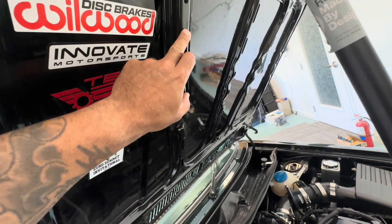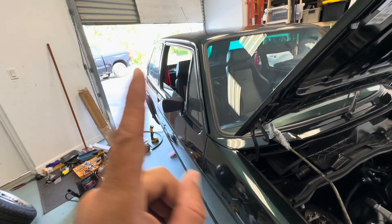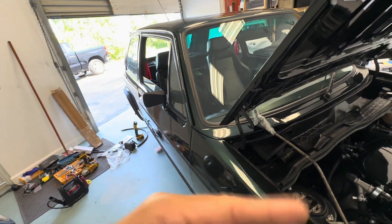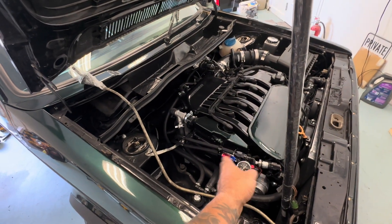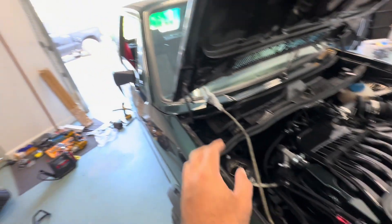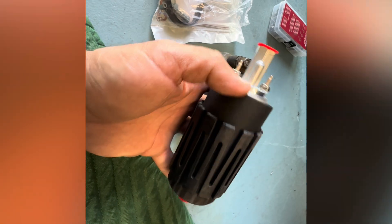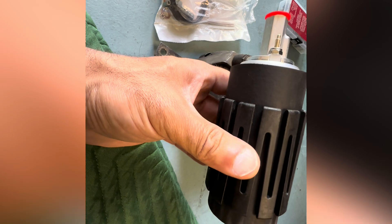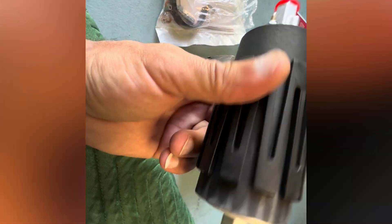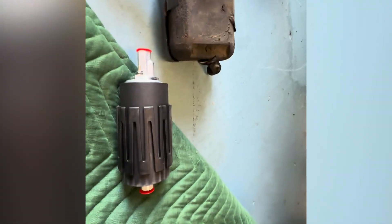I want to work on the fuel first, so I'm going to pull the fuse and purge the fuel to drain any pressure so I can start eliminating this and install the new pump. I'll be right back. So it has its own little sleeve — this is from the 044 — it creates the exact same size. What's interesting about this fuel pump is that the flow is this way, while on other fuel pumps it accepts fuel one direction and goes out the other, so this one's reverse.